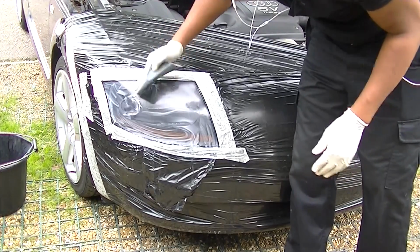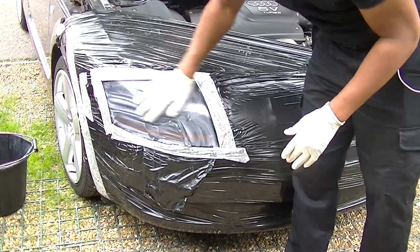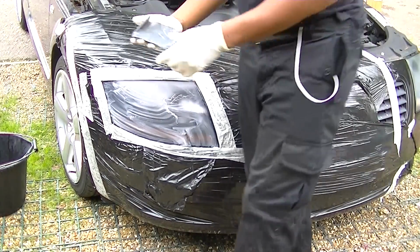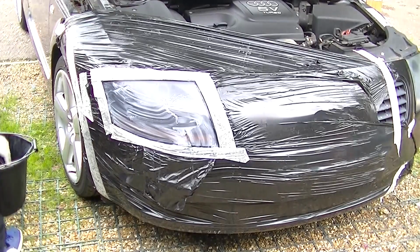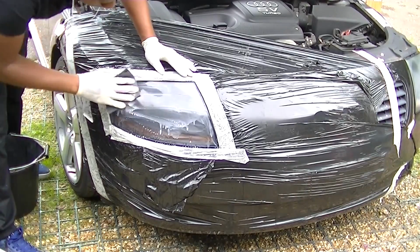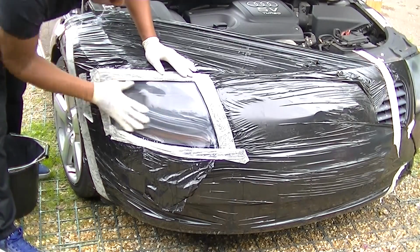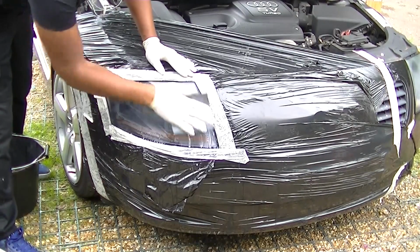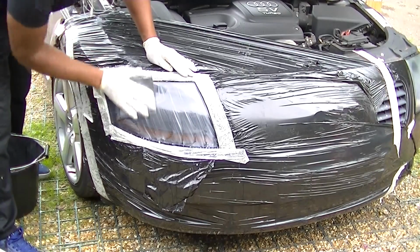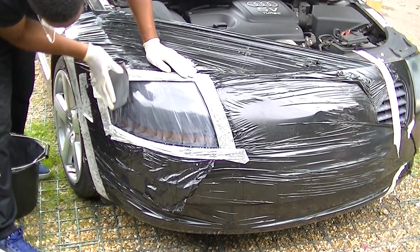So as you can see, I'm just lightly rubbing it down, and there's lots of this white stuff coming, and you will start to hear the surface smoothing out. You hear less roughness, and then you know that's where you're supposed to be. But always remember to keep it lubricated so you can just rub it down nicely. Now this shouldn't take too long, best part of 20 minutes, 15 minutes if you're particularly fussy. And if you're not happy from here, you can actually add another coat if you have got a major problem. So everything's reversible and fixable.